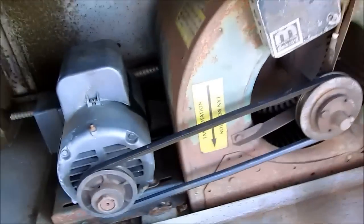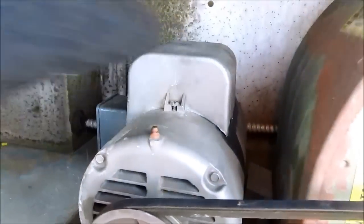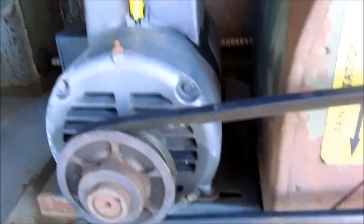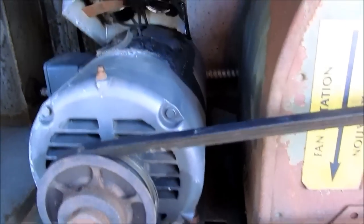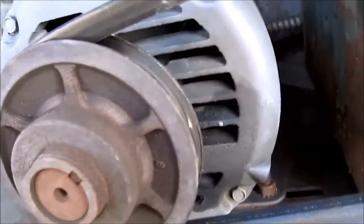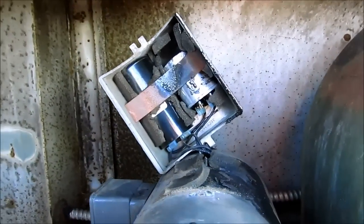Belt's really tight, and one thing you notice — see that oil? See if I can salvage this motor; it's not cheap. One thing I noticed is that something's leaking in there. Looks like the cap's leaking, so it's leaking all over. Let me get that cap out of there and find out if it's good or not, and let me check the start cap.